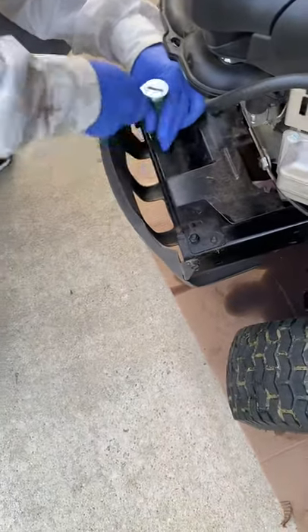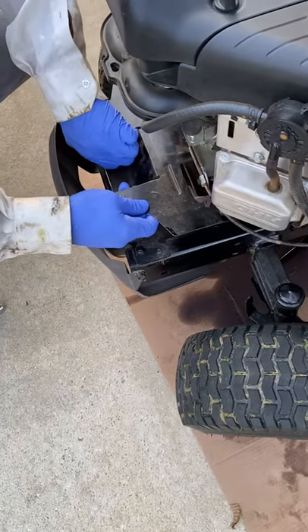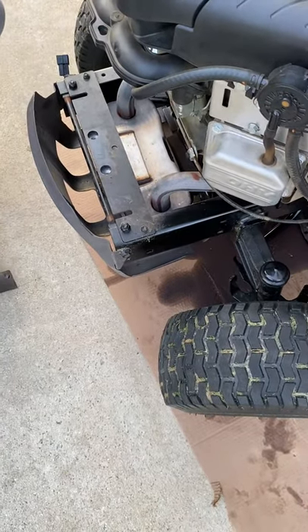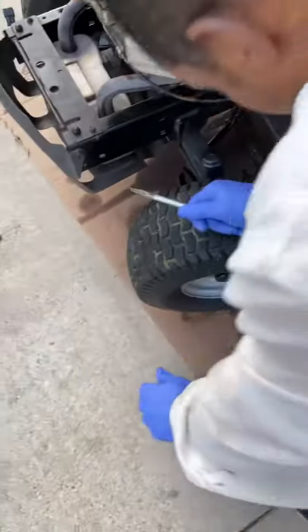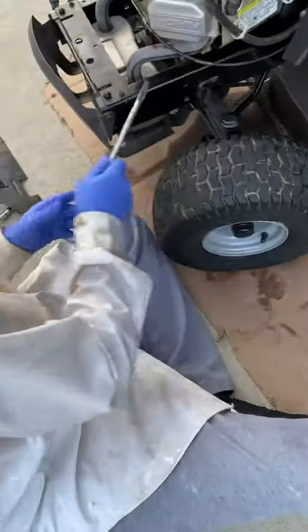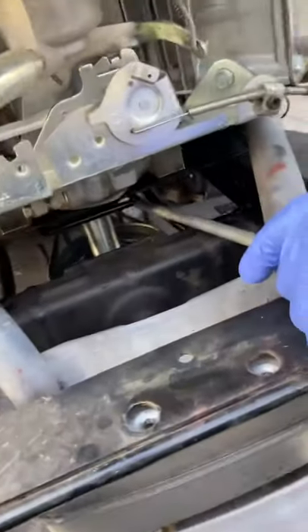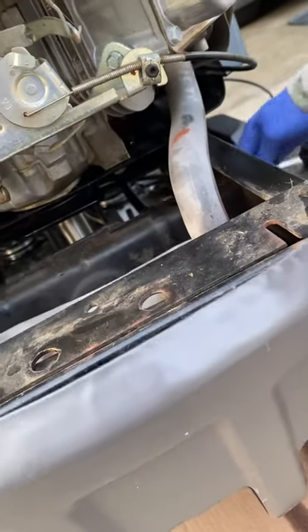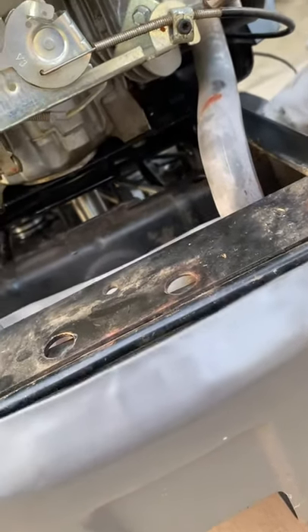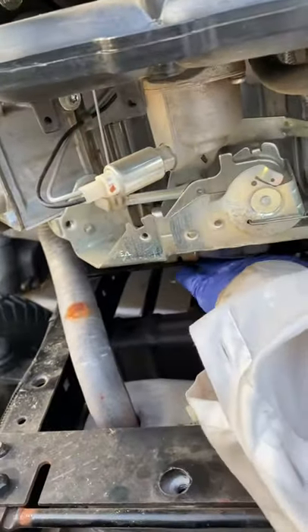Take these two here out — that's your exhaust, so it'll drop down a little bit when you take it off, but that's okay. Then you come here. What I did is I got this little flat tool, and there's a keeper in there. This thing right here is the keeper, and the belt is up there. So I came just right under here and got some leverage against the pulley that's down below, and opened it up just enough to slip the belt on.